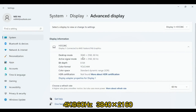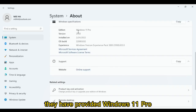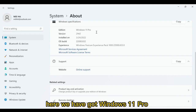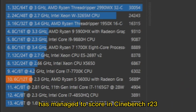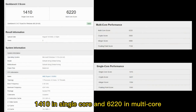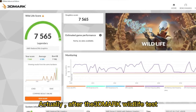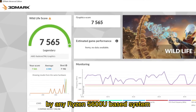Confirmed: 4K 60Hz at 3840×2160. Device specifications show AMD Ryzen 5 5600U with Radeon Graphics at 2.3GHz and 16 gigabytes of RAM. I'm very satisfied to see Windows 11 Pro, since most other brands don't provide that out of the box. In Cinebench R23 this Atop Nook scored 5689 — a very good score for a Ryzen 5600U mini PC. Geekbench scores are also very promising: 1410 in single-core and 6220 in multi-core. After the 3DMark Wildlife test I was truly surprised — it showed legendary performance, the highest score by any Ryzen 5600U-based system — beyond my expectations.